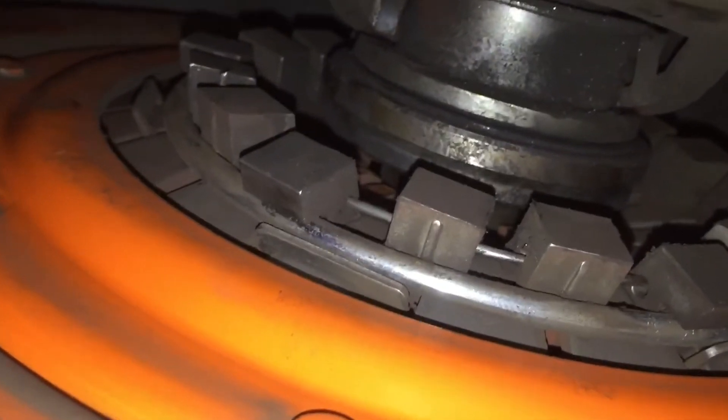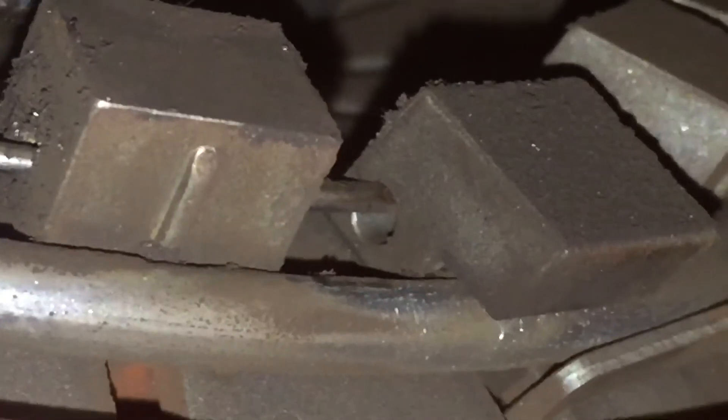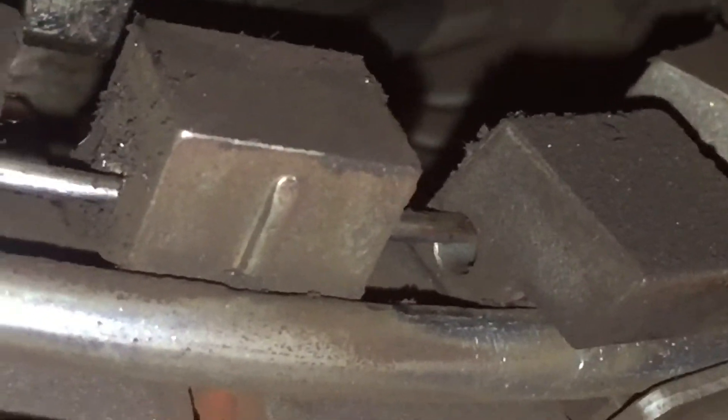In this case, for this car — a 2003 Ford Mustang Mach 1 with the TR3650 five-speed, the same five-speed in all Mustang GTs basically from 2001 to the end of that body style — you won't be able to get these weights off because they will hit the throwout bearing as you snug them down. I went ahead and cut the wire, which was kind of a no-turning-back process, and confirmed that those weights will not come off unless you pull the transmission back.